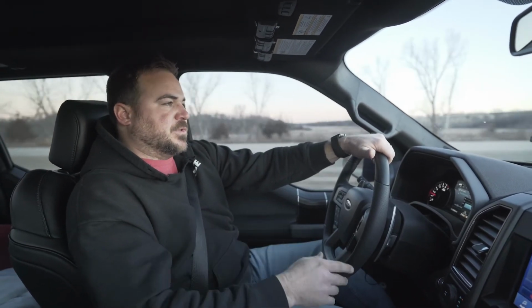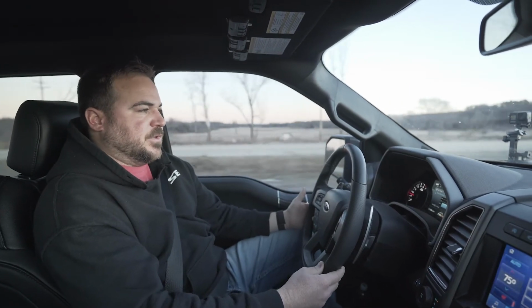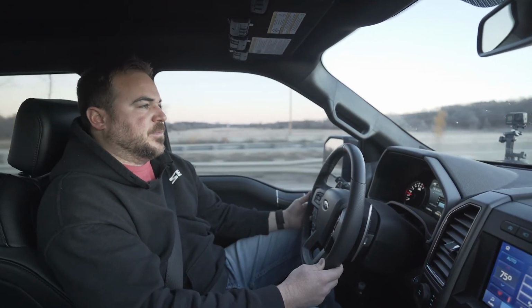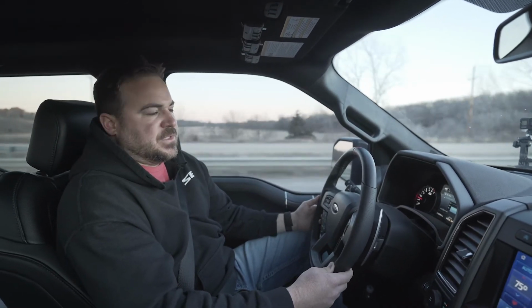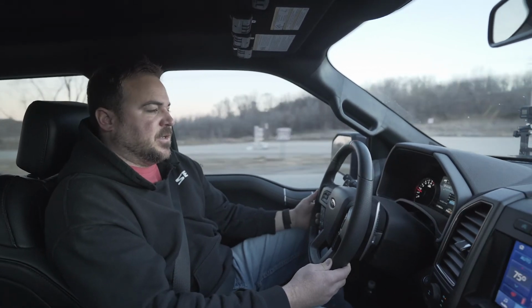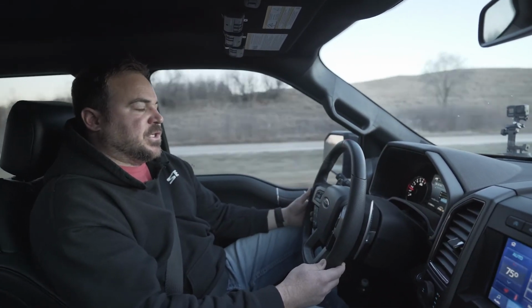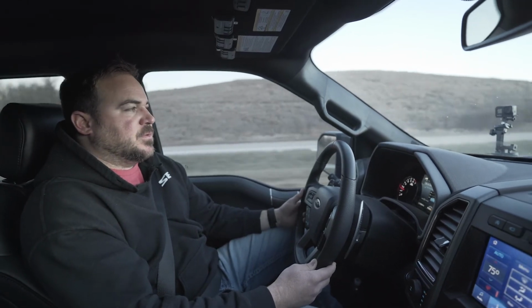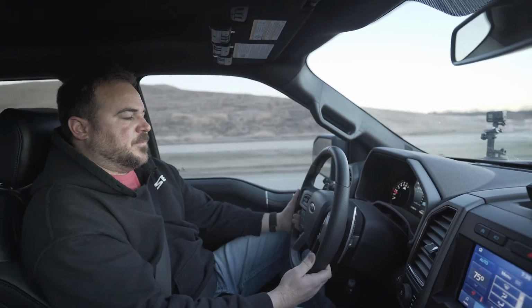The larger turbos are pretty good for rapid spool up. We didn't really even notice a difference in spool up between a factory turbo and these. We just noticed that there's 30 or 40 horse that can be sustained on these turbos, because at 20 pounds of boost, shaft speed's quite a little bit lower per given horsepower.